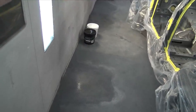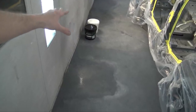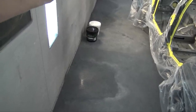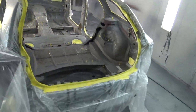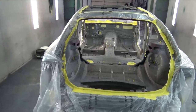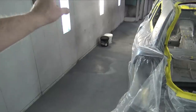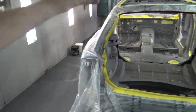This thing is ready to go. All I have to do is mix it up — it's water-based so I just stir it up with a stir stick, or it comes with the spray gun which actually comes with a stir attachment for a drill. I'll put the links in the description for this stuff — it's a sound deadening and heat barrier. One thing to note: you can only spray one coat every 24 hours, so I'm going to do the sound barrier today and then tomorrow I'm going to spray the heat barrier.